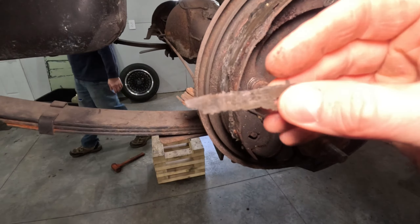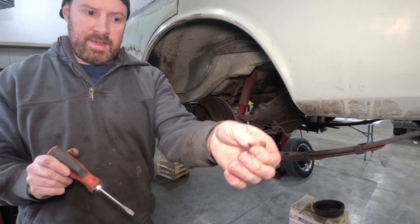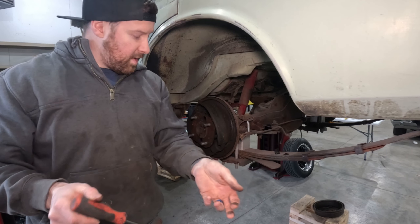The pin came out of the retaining washer in the spring here - that's what holds the shoe on. Those popped out, that's why the shoe is flopping in the wind. There's a little more meat on this one, but the pad material is just turning into nothing.